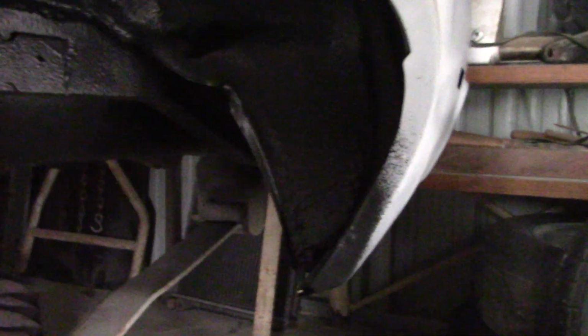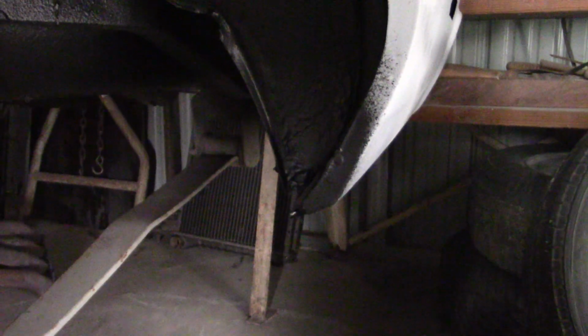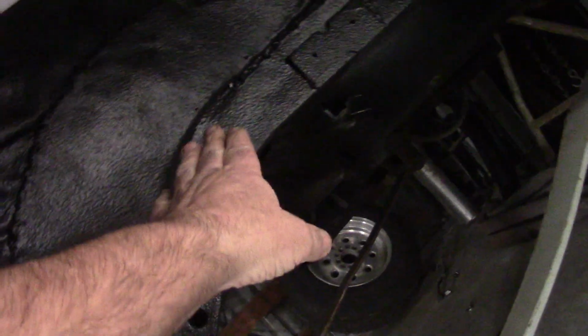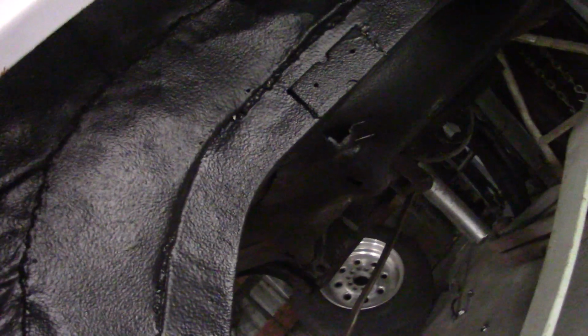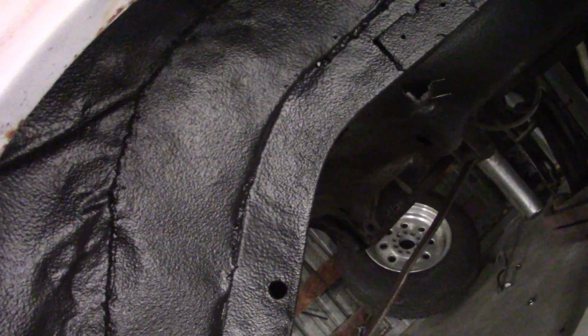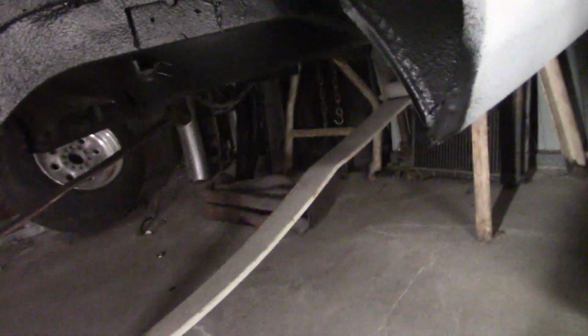These were supposedly re-arched. When I was younger, I took it to a spring shop because what I did here was put the competition engineering spring relocating kit in the back, and it moves the spring in, and that's not the issue when you're trying to put a tire on a Nova. Come to find out, it's the shock. Shock usually mounts right here on the frame rail there, and I've eliminated that, and put a little mini tub in this years ago, crudely, but pre-Detroit Speed, you know what I mean?